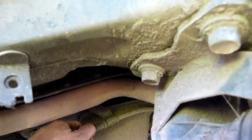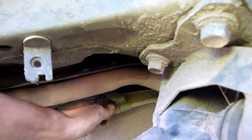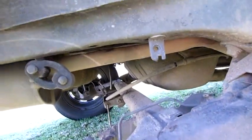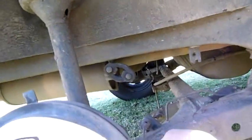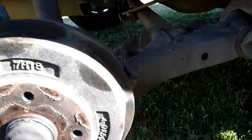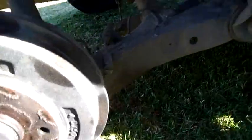Hydraulic park brake? No - it's a swaged fitting but it's a cable. It just looks like a hydraulic line with a shield over it. That's a rigid cable and it just yanks on both sides and pulls this in. So if the hub's spinning and you pull on that, it stops - sort of like the old school car brakes, which were all cable operated anyway.